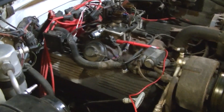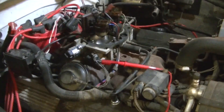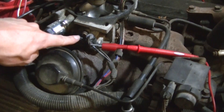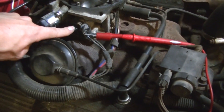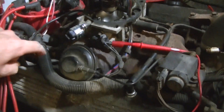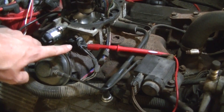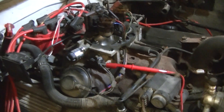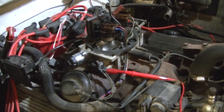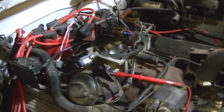I've got the multimeter hooked up and I'm going to the blue wire off the sensor. There are three wires — blue, black, and white. I've grounded the other one to my battery. The blue wire is the sensor output — it tells the computer that the throttle is closed all the way, essentially telling it to idle all the way down.